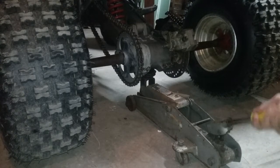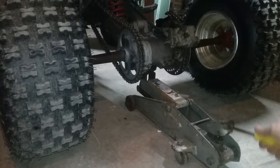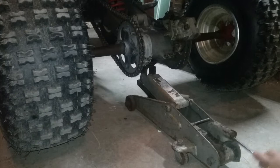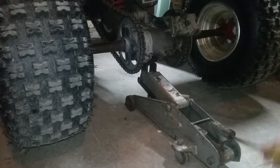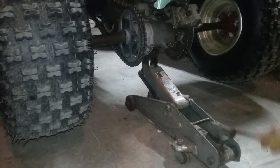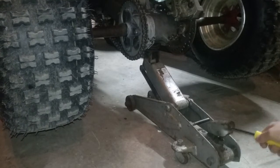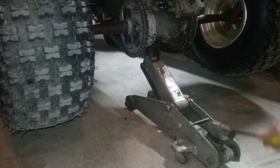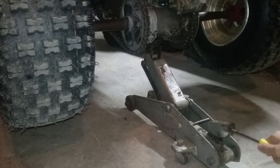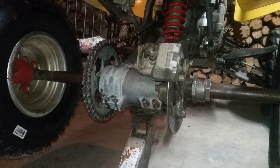The big screwdriver is going to come in handy for a few different reasons. You don't have to jack your wheeler up crazy high, but jack it up a little bit because you need good leverage. The holes that you shift the carrier with are wide, so you want a pretty large screwdriver. Jack it up just enough so you have room to get the screwdriver up under there.